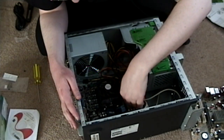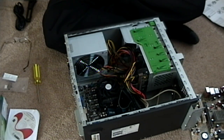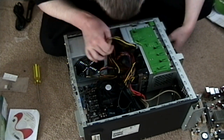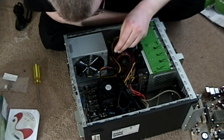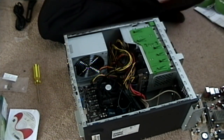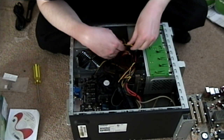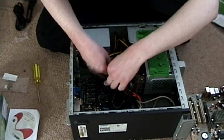Okay, so I think that takes care of all of our internal devices. Do not forget to connect the four-pin ATX plus 12-volt power plug — otherwise the system will not power up. That is this one here. This one we don't need right now, so we're going to stash it over here. My spare five-and-a-quarter-inch drive bay has become the stash for unused power cables.